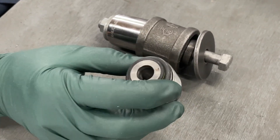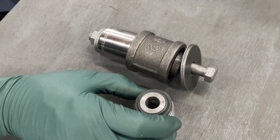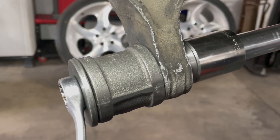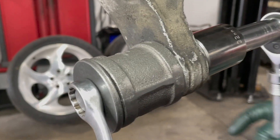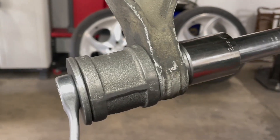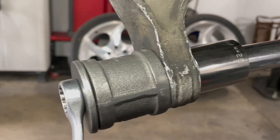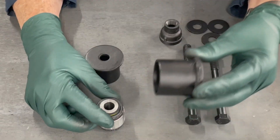I recommend that if you're doing a coilover conversion, you just plan to replace this bushing right here. If your car has over 150,000 miles, you might want to replace a number of bushings in the rear end, but this is the primary one. I only sell quality bushings, and I've come up with a press tool — watch as I demonstrate how I use this to install these in my own car. I will be selling two bushings, a couple of special tools, and this press tool together as one kit.